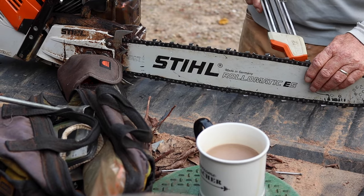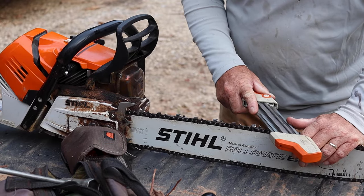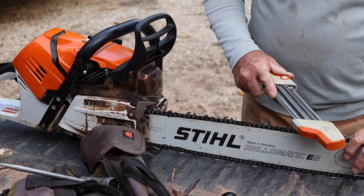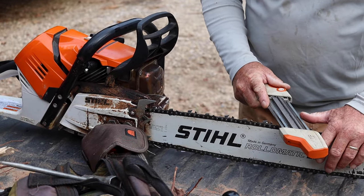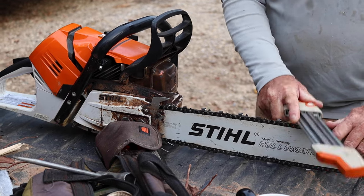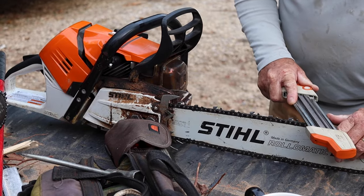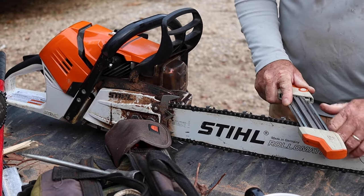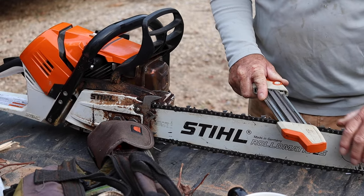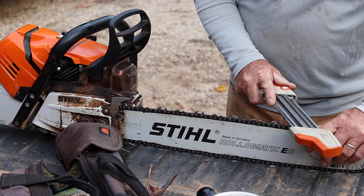So the meat that I'm filing under here is like underneath your finger, which holds your nail and gives your nail its strength, right? So the metal that I'm filing off is the metal that holds the chrome on there, and then I'm just cutting the edge of the chrome. It's like a razor blade. It really is. I mean, just the engineering behind a chainsaw chain is pretty incredible, and honestly, it's changed some over the years, but if you look at the old chains from the old Poulan and Homelite saws, professional saws back in the day, the chain's about the same. There's material changes, I'm sure.